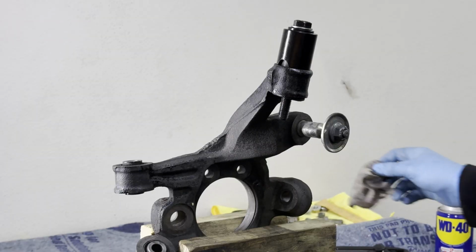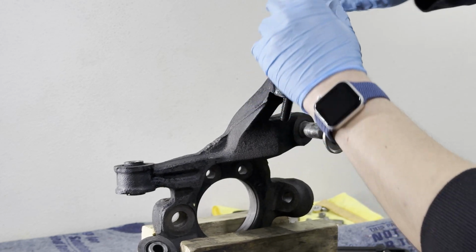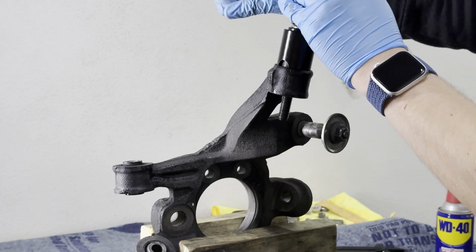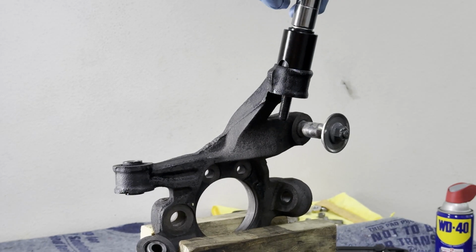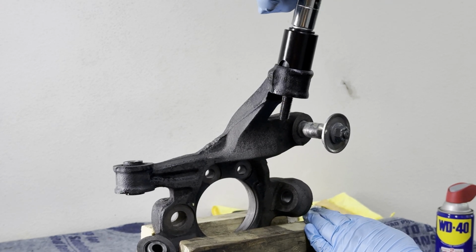To make this job a little bit easier, I did purchase the GK Tech knuckle bushing removal kit. With the kit, it has a bolt, 2 washers, and a specialized machine receiving end, in addition to a nut locker to be able to crank away and remove the bushings with ease. Just remember to apply grease to the threads or otherwise you may damage the bolt.